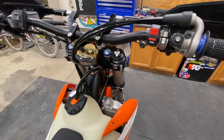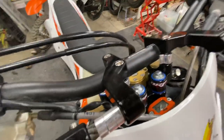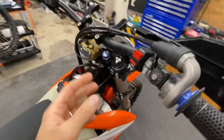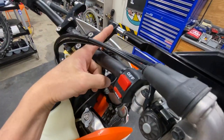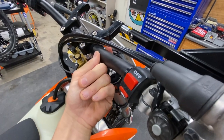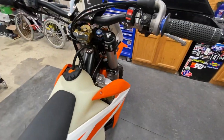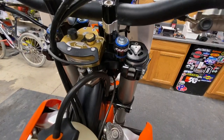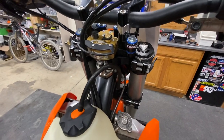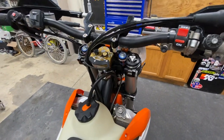We use the Reflex Racing guards — this is the Recurve version. When the clamp comes over the top and becomes the bar top, that's the Recurve. The standard version has a C-bracket where the bar end would just come straight down and grab the bars. The Recurve is sturdier and a little bit cleaner — a nice smooth, uncluttered appearance. Then there's the BRP damper for isolation on the mounting and the Scott stabilizer — all from Jimmy over at BRP. We went with the blue bushings instead of the red — the softer option — since the rider wanted as much wrist dampening as possible.